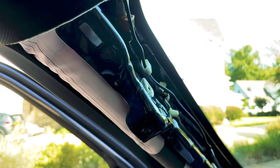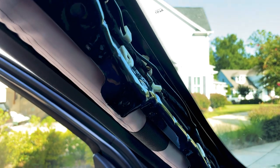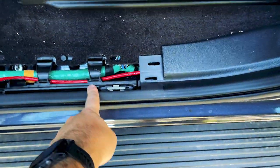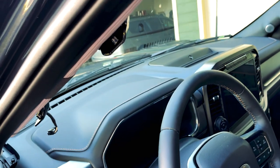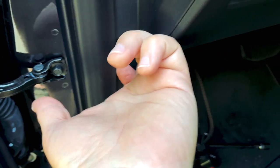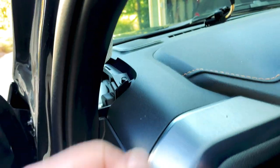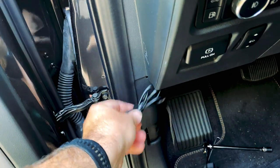What that does is get you behind this airbag — this guy's a side curtain airbag, so he's going to come down and block any flying glass if you're in an accident. You don't want to take the easy way, which would be pulling up this weather stripping and running the wire there, for exactly that reason. Do it the right way, because that curtain airbag would save your life. You can work the cable back behind the trim piece with a little up-down sawing or flossing motion, and it'll flow freely behind there — super easy.